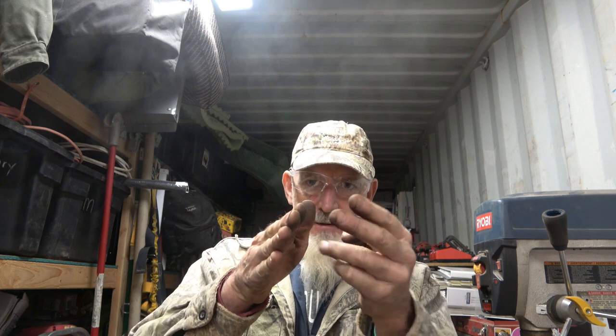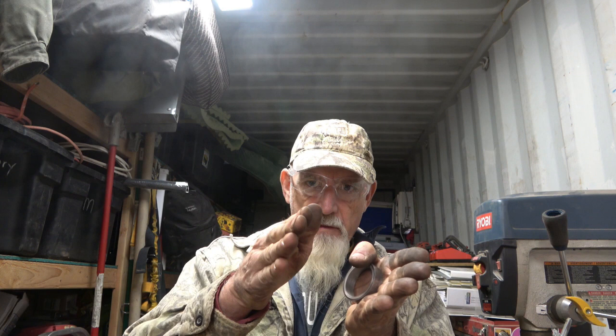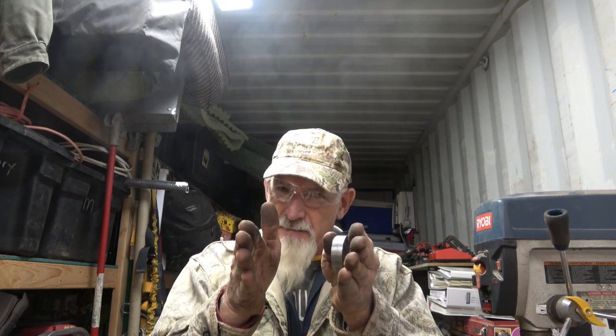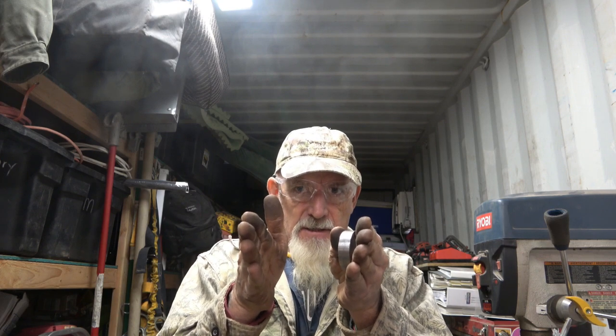That's the purpose of the ball joint leading up here, is that it will actually travel with the motorcycle and go back and forth like this. It'll turn, and I think it'll really help on control, and I think it'll help on stability. I'm also going to make a lock on that sidecar, so if I get into a situation like a sandy situation where sometimes they get pretty heavy and I don't want to tip that whole thing over, I'm going to put a lock in this so that it'll be like a trike in a way, or a sidecar that doesn't tip. So, but anyway, that's what I'm going for.